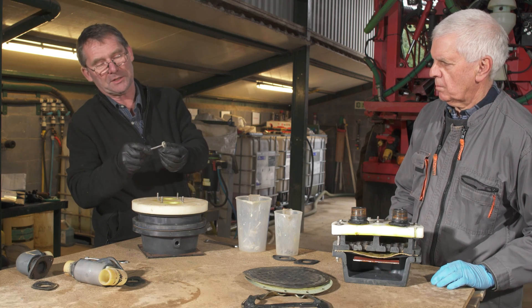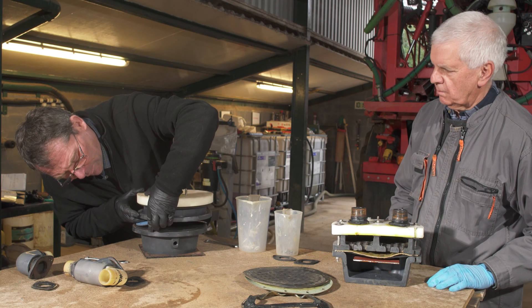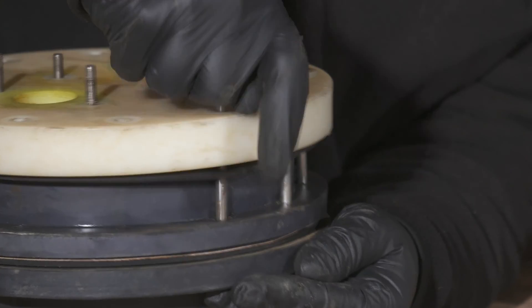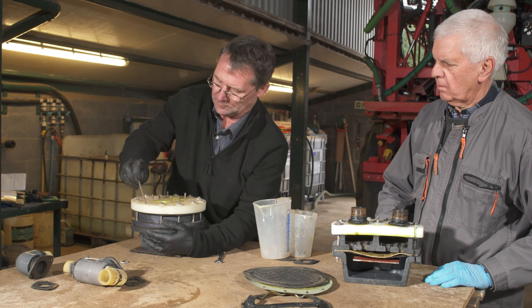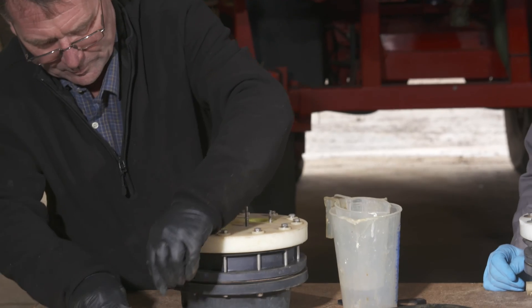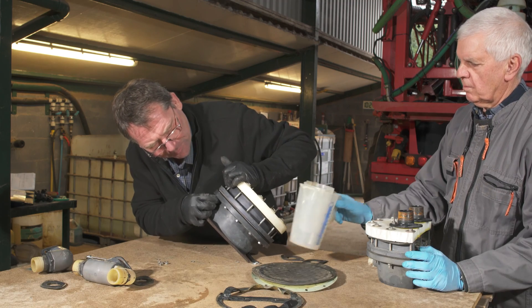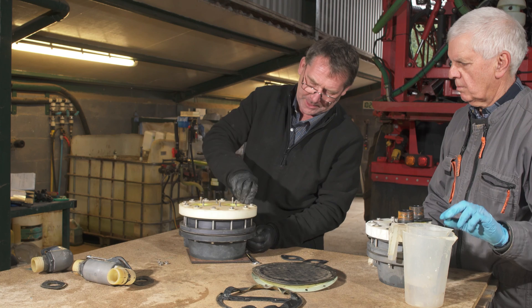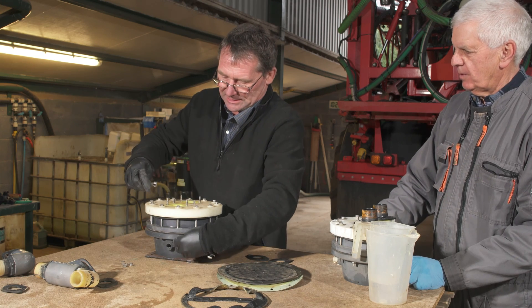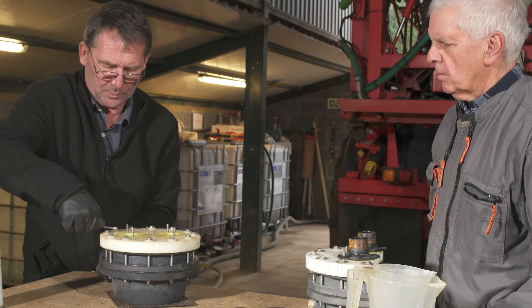Having taken the bolts out, you've got the plastic cap on the top. Your first few bolts are always going to be the hardest ones to line up — once you get a few in place, the job will become easier. Do them all finger tight to begin with, because what we're basically doing is squeezing rubber. There is no official torque setting — it's hand tight, work around them gently to begin with, get them to a similar sort of feel. Right, I think we're all good to go on that part.